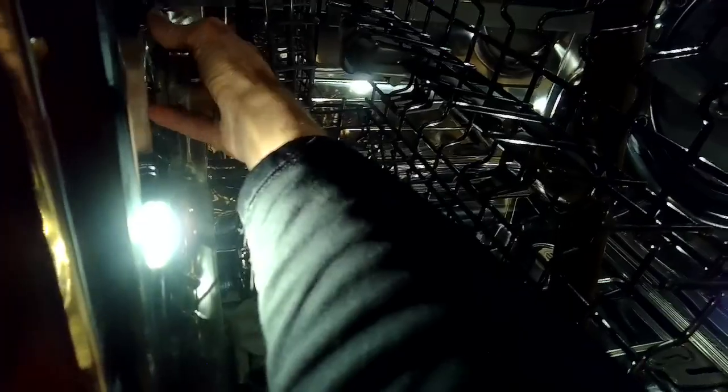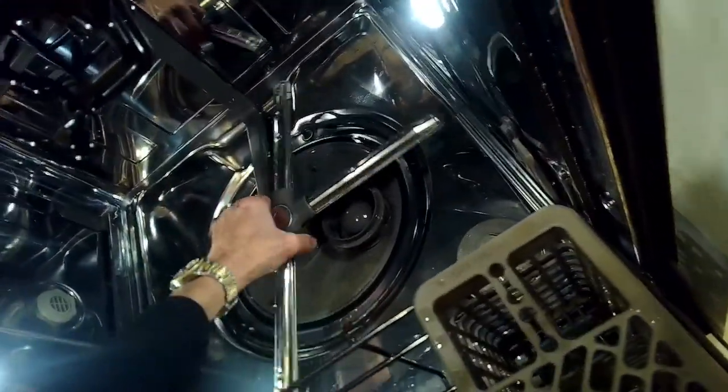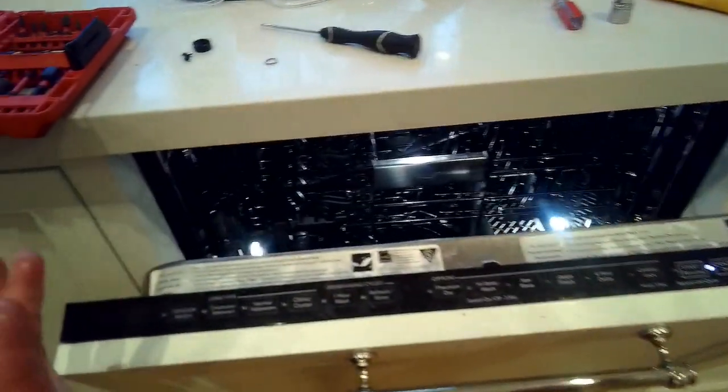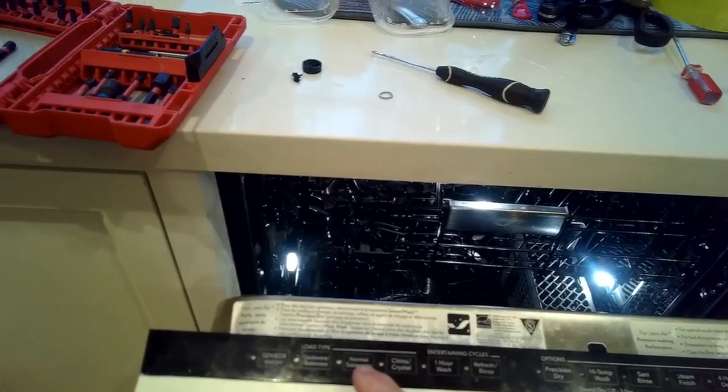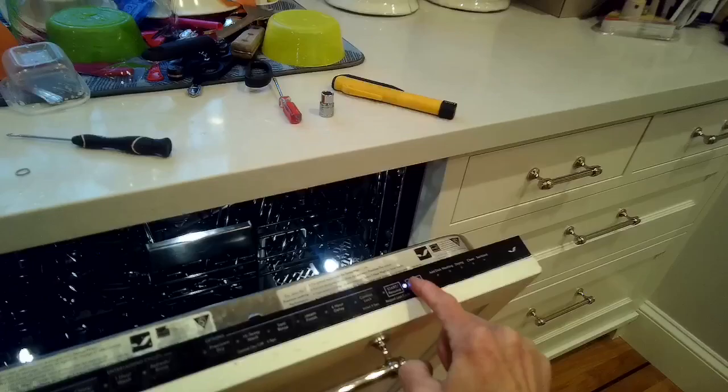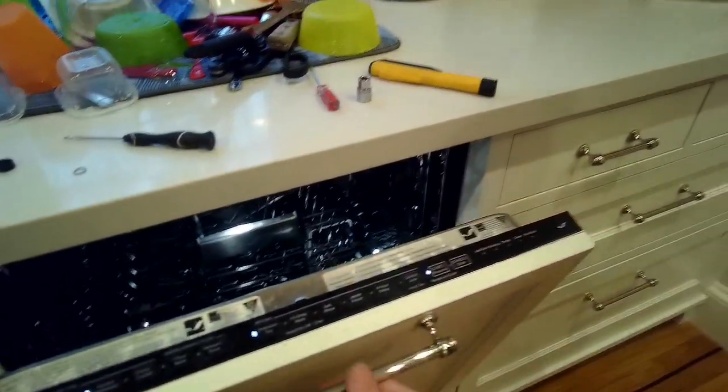When I tested it, I opened the panel underneath to see if I could see any water leaking out from the diverter motor, and there was no water. Just putting in that new seal will do the trick. The important thing is to get that hook tool, because it makes it much easier — I tried using other things earlier and it just didn't work. I hope this has been helpful. Please subscribe to our channel and thanks so much for watching.